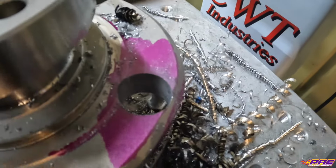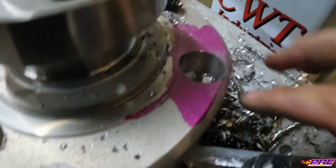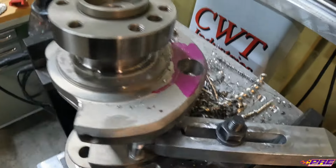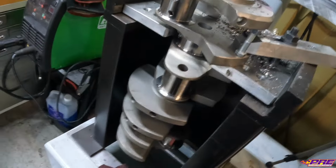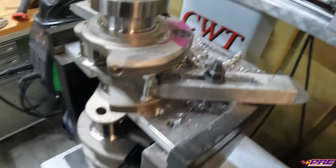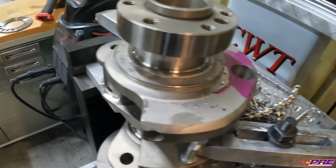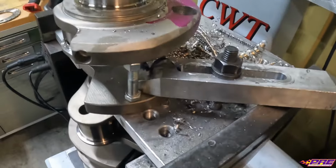So that's the first hole drilled and reamed. We'll get this cleaned up. We'll deburr the edges a little bit right before we put in heavy metal. That's pretty much it. We'll get this flipped over to the front side so that both holes are already in. We can then get our heavy metal. We can get it froze. Typically we use liquid nitrogen. We can freeze that just so that it'll drop in a little easier.